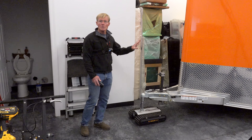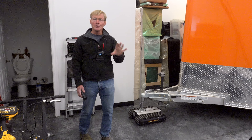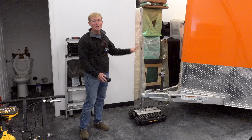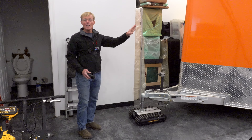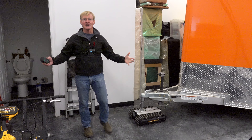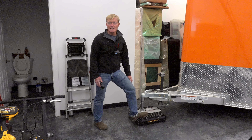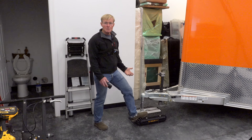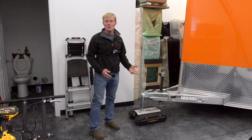The RVR will take it up and down an incline — I don't know how much, I'll leave that up to you to figure out. I don't really think that's the main purpose of these. Moving around in a parking lot, a garage, or a driveway — that's what these are for. If you've got a long or steep hill, odds are you're going to be hooked up to a truck. I'm not going to take something that weighs 75 pounds and have a 7,000 plus pound weight moving on a steep incline — at some point physics is going to take over and it's not going to be able to stop it.